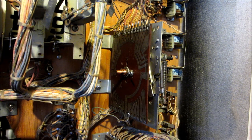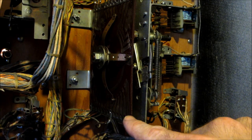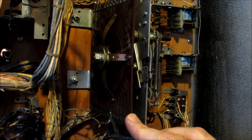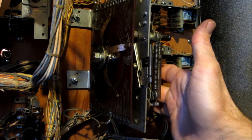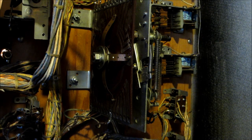Here's where I took the spider off and it's pretty dirty. I'm going to try cleaning it up with alcohol and then put a little bit of lube gel on there, put the spider back on and see if it's clean. Here's the ball count unit after cleaning the bakelite circuit board and the contacts, then applying a little bit of Teflon gel lube. Let's see what happens right now - it's at ball position zero, I'm going to act like I'm going through the ball sequence and then reset. See how that goes right back down - before it was going really slowly, so I think we're in good shape.